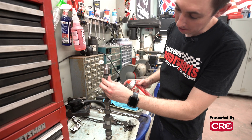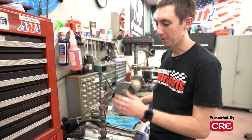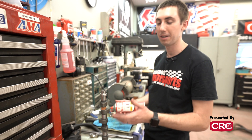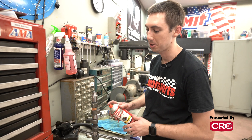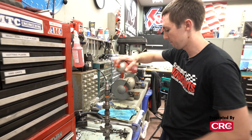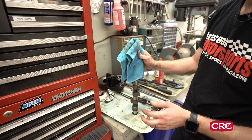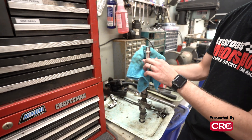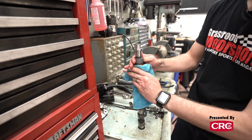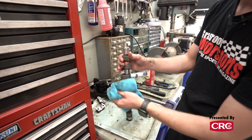Because this cam came packed in cardboard — which is paper, which is bad — we want it as clean as possible so we can coat it with assembly lube. I don't trust whatever's on it from shipping, so I'm just going to spray it down real good, wipe it down, and treat it like any other dirty old part. You can't make something too clean when you're putting together parts inside an engine, so always err on the side of caution and clean things two or three times.